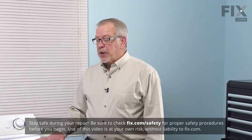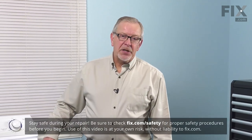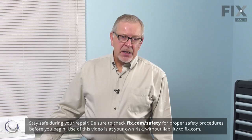Now to do this repair, we will need to disconnect the washer from all of its supplies. So first thing we'll need to do is pull it forward, disconnect the power. We'll also need to turn off the inlet water supplies, remove both fill hoses, and pull the drain hose out of the drain, and then pull the washer forward so that we can access all the way around it.